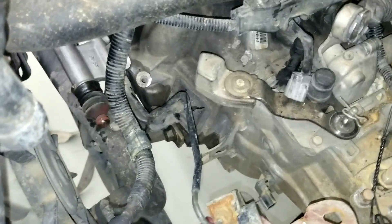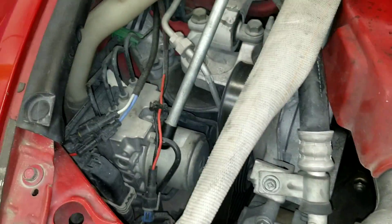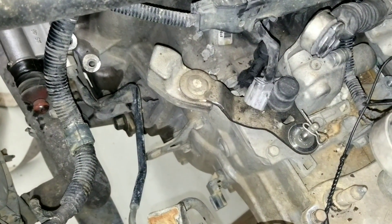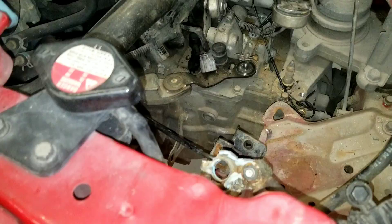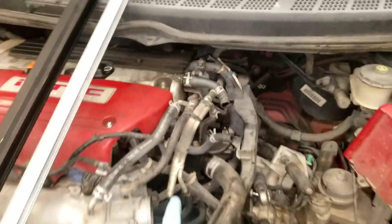So we're done up here. What we're gonna do is get the car up and remove this front mount and then the back mount. This motor mount or transmission mount and this one will hold the engine in place while that little subframe down there comes out. Once it's out we're going to hold the engine in place with the trans jack and it'll be out — or actually we're gonna do a crossbar to support the engine up, and then we will take this out.